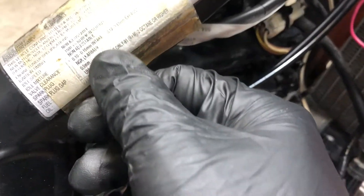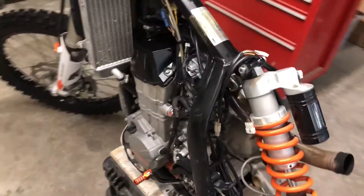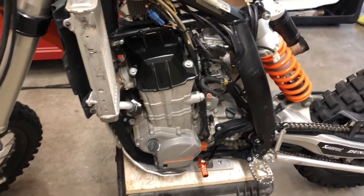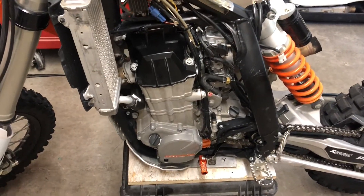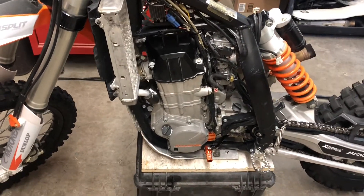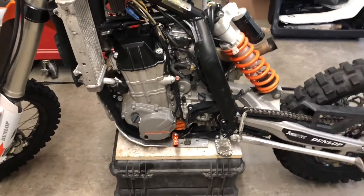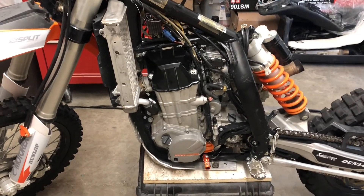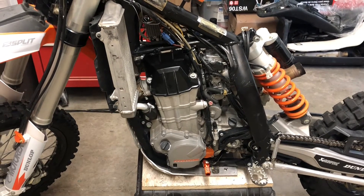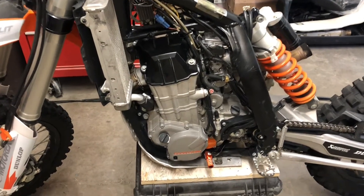One of the things that entails is setting the valve clearance, and this tag right here gives the specifications for valve clearance on this engine. This engine apparently needs to be checked fairly often — check your owner's manual, but it's part of a regular maintenance item. Now, this generation of KTM, the '08 through '11, uses valve shims, which is different than the system that preceded it. So instead of being able to adjust the clearance right there on the cam and rocker assembly, it actually requires that you swap out shims. So we'll see if that's needed.